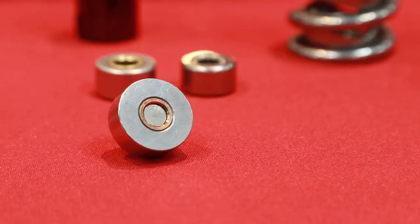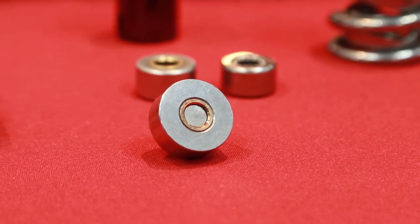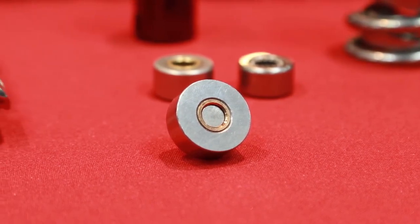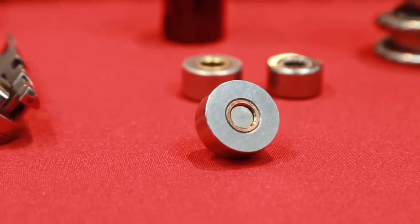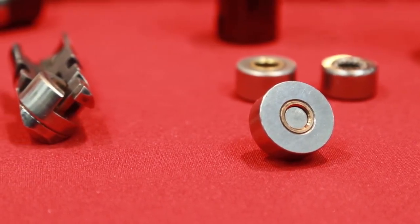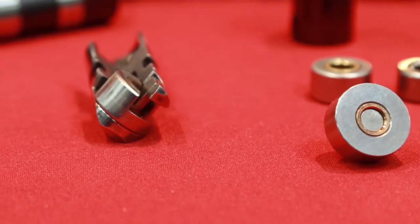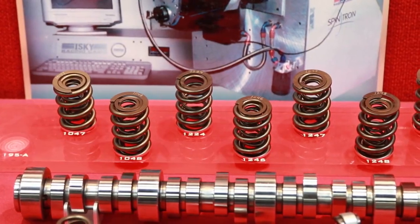So we take the Harley lifter, and all we do is put the bearing, the Easy Roll bushing, into it, and the guys get unlimited life out of it. No more problems, just because it's a better engineered piece, and it's a new technology that they didn't think of. So this makes all the difference in the world. Performance, they don't have to tear apart the engines. Everything lasts a lot longer. Let's talk about that long term too.